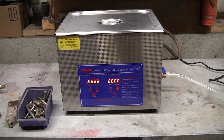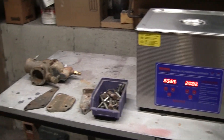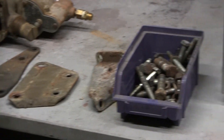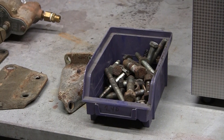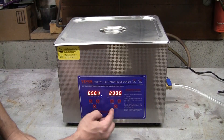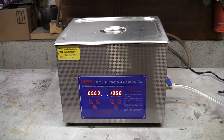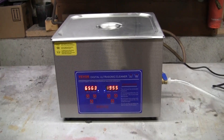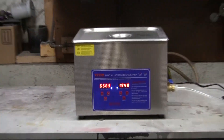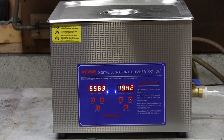It's at 65 degrees Celsius — I'll put in the Fahrenheit conversion after I edit this video. We're going to put the carburetor in a second time; the first time was just a real cleaning from the Dawn and water. We also have these plates and a bucket of bolts and springs and stuff that I'm going to leave in the ultrasonic — I want to see what it does. I'll cover that up and do it again. Same 20 minutes. I will see you guys back here in another 19 minutes.